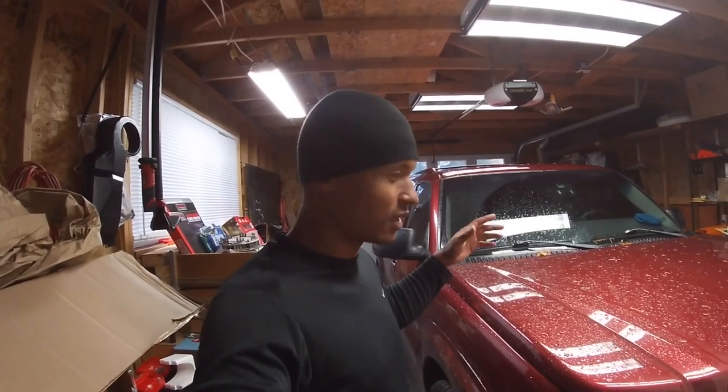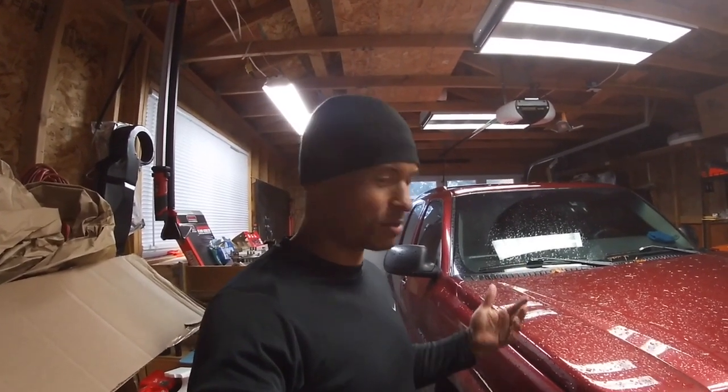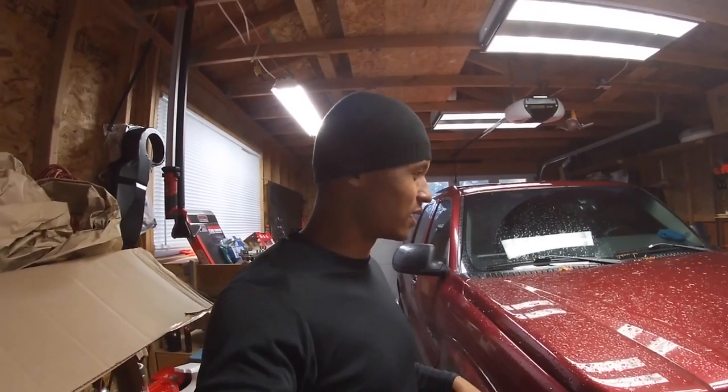These are just an Amazon brand from Detroit Axle, and I'm not knocking them. I think it's partly my fault for why they're squeaking because I don't think I cleaned the rotors good enough. Also, the brake pads had some sort of weird substance on them. I figured it would burn off, but it gave a weird smell, and now they squeak like crazy — when it's cold, when it's warm, definitely more in warmer weather.